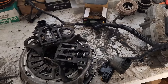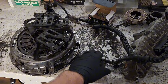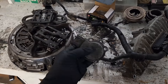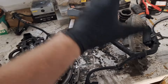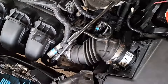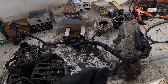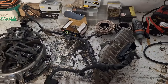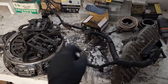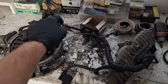Clear the codes out, drive the car, and wait until the issue starts acting up again and the check engine light comes on. Check the code. If the same code comes back, then you know it's not the actuator. At that point, pull the airbox out of the engine. There are a couple of grounds underneath the airbox — make sure they are not loose, are in good condition, tight and clean, not corroded. A loose ground under the airbox can cause this issue. If that ground is tight and clean and you swap the actuators and the code did not change, but if the code does change to the opposite clutch, then you know the actuator is bad.